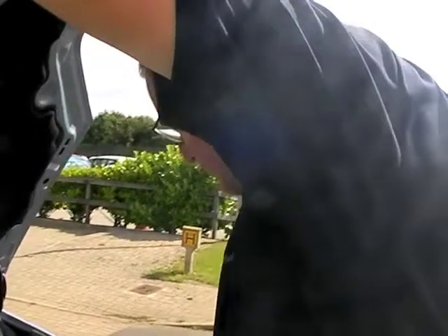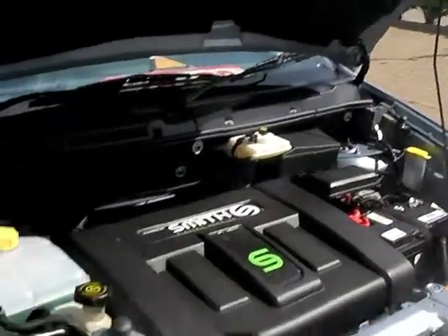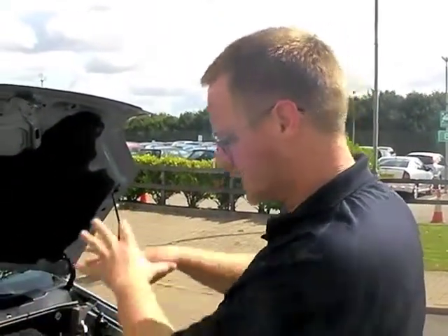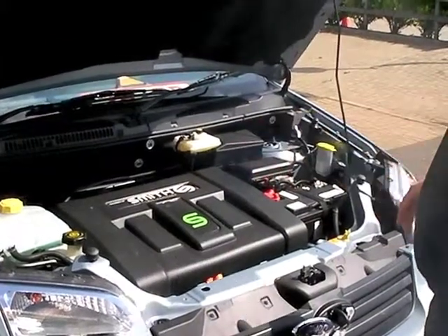The whole ethos for us is to take a vehicle, an established chassis like this, and then it's our challenge to fit our technology into that existing space. So we don't interfere with the load carrying space on a commercial vehicle, or with the seats on a passenger vehicle. The battery sits where the fuel tank is, and under the bonnet where your ICE drivetrain was is where you've got your motor and your controls.